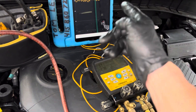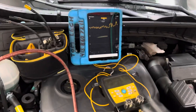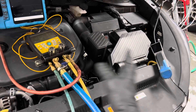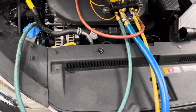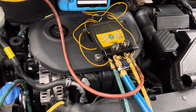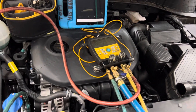That's all for now — I'm about to charge this Hyundai. It's going to take R134a, 550 grams. I've got to set up the rest of my sensors for temperature and I'll be going over it using the leak detector. This was a front-end collision. They removed the condenser to replace some sheet metal where the lines went through, then put the original condenser right back on — so these are all the same parts. Its only exposure to atmosphere was while it was taken off, and hopefully it was taped up.